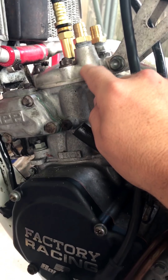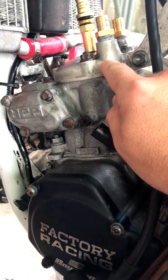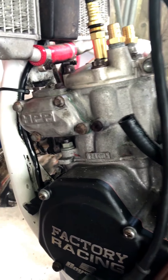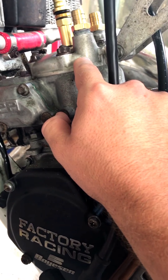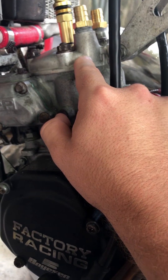When I flipped it over, the underneath of the cylinder head is marred up. I don't know if this cylinder head was changed prior to me buying this and it was a used one, because the top of the piston isn't chewed up but the underside of the cylinder head is chewed up. I'm kind of curious what would actually cause that to happen, but it's gonna need a new top-end rebuild.